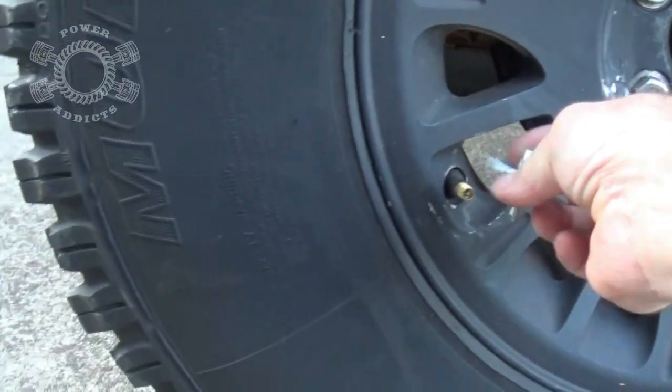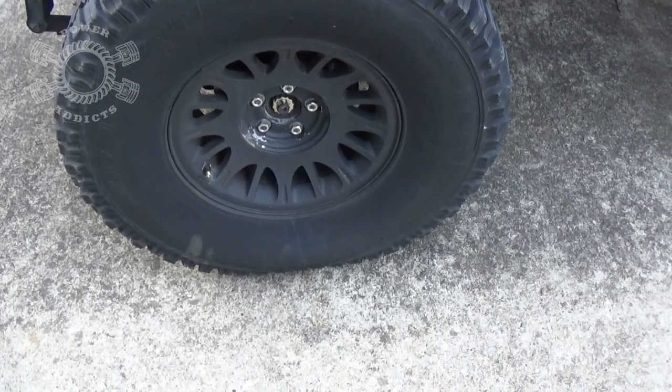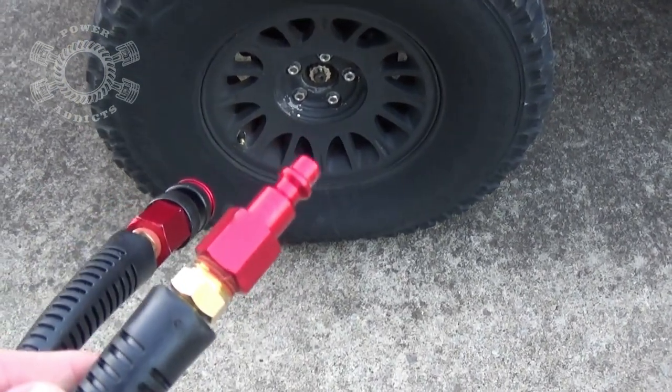Sweet. I was about to edit this video together, then I realized something. Someone's gonna ask me, do you have to have the throttle control? Do you have to idle it up to blow up a tire? Absolutely not, you don't. So here's what I'm gonna do. I'm gonna do that tire at idle. Pull the Schrader valve. So while my tire's going flat, let's hook up the airline.